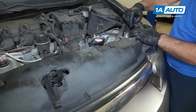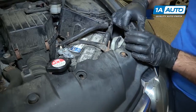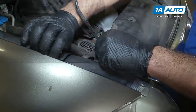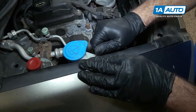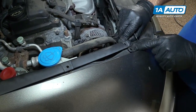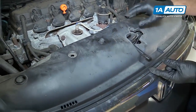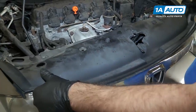Do the same on this side — just pull it up, pop that pin out. Push it this way a little bit and lift that up. It's got a lip that's pushed into the grille, just pull it out. Pull this trim out. I need to pull that clip out. I'm going to pop this one up so I can move this trim a little better. Just need to slide it over, then pull this out from behind the grille. Slide it up and off of the hood latch, and kind of flex it off.